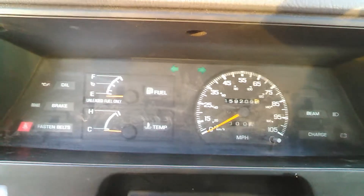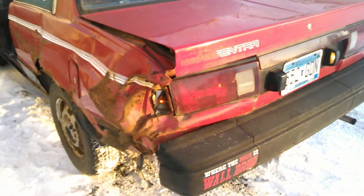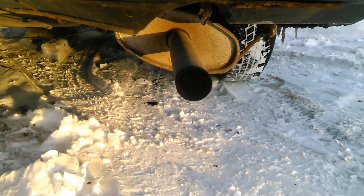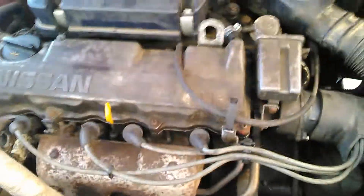Here's the spot of damage on the back I was talking about. Brake lights work, turn signals work, exhaust is clean — we're not burning any coolant or oil, so it's a solid engine. Tail plate lights work, you can already see the headlights, they're actually pretty bright. That turn signal works. There's no misfires, jumps, skips, squeaks, or anything in this engine — it actually sounds really good.